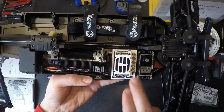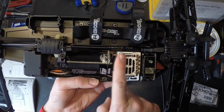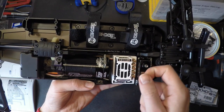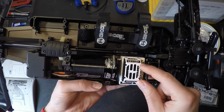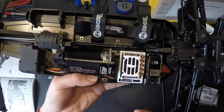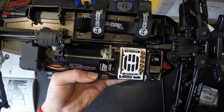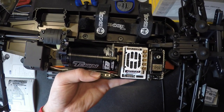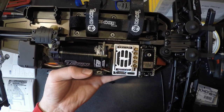The second thing is the RX-8 position. I've often done this with posts on the back to get the shortest wires possible, but I'm doing it on purpose this way — I'm going to take all the wires up and twist them slightly when I solder, so all wires come around the inside, leaving the fan opening available. On a truggy running 4S, I am going to put the fan in there and I want to make sure there's plenty of available air for it to work with.